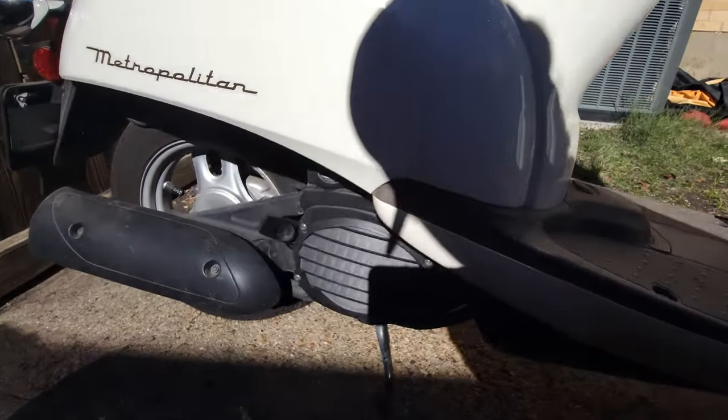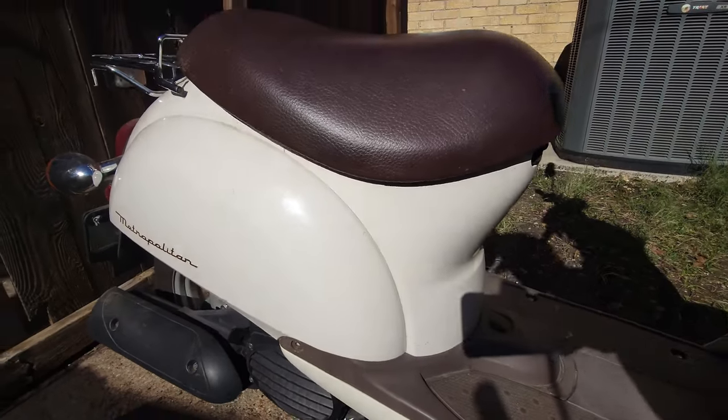A couple of things that are different about the Honda Metropolitan: it does have a radiator, so you'll need to make sure your fluid is topped off — keep that in mind. Also, the Honda Metropolitan does not have a manual choke. To rephrase — you don't have to manually adjust the choke; it has an automatic choke that adjusts itself. That's awesome for anybody who doesn't completely understand how the choke works. You just turn the key, hop on, let it warm up, let it do its thing, and roll out. No sitting there adjusting it — you know how it goes on some bikes where you slightly move it and it dies if it's not in the correct position. Eliminate all that, start it up, get your gear on, and roll out.